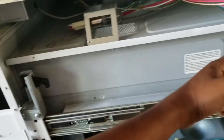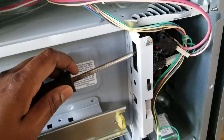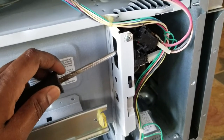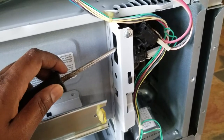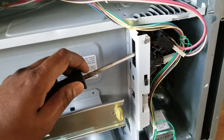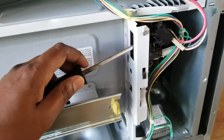What happens when we close this door is this object peers through and tries to push this thing. I'll try to do it by hand or maybe with the screwdriver — it pushes this thing up and you will hear a click sound. See how hard I have to push for that click to happen. When that click happens, this always-open sensor becomes closed, and that's when the system senses all the switches are working fine. Over time this switch just goes bad and you can see it's not functioning very well.